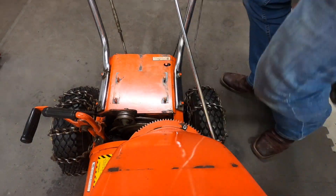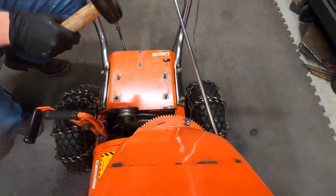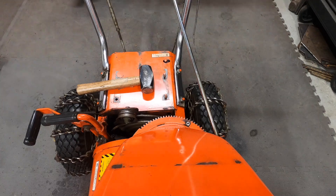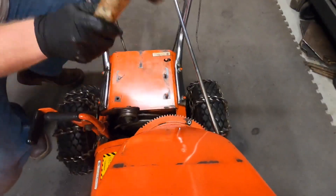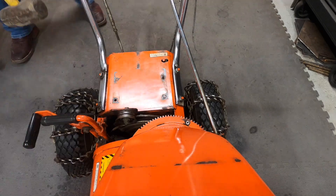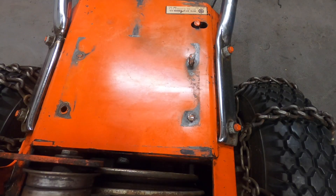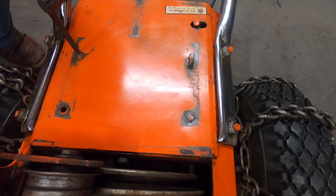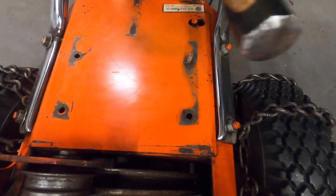These four studs that you're going to see me hitting out of the mainframe of the snowblower are what hold the engine to the frame. They're spot welded from underneath, so it's not very difficult to get them removed, although I did have problems with the last one — the top right one. It ends up warping the top plate of the mainframe slightly, but it does not affect mounting the engine, which I just end up mounting with bolts and nuts purchased from the local hardware store. I used grade eight. I had to get the big hammer out, but that still didn't do it. I ended up throwing some heat on them with a propane torch and it definitely helped. I was just making sure that nothing underneath was holding it — I didn't want to damage anything else trying to get that bolt out. I'm using the proper tool here, a hex three-eighths drive. We're going to get that last bolt out and get the engine bolted up.